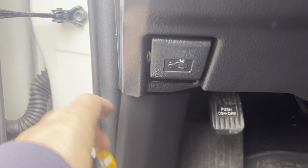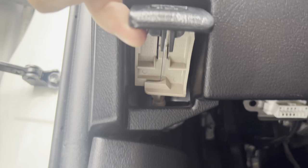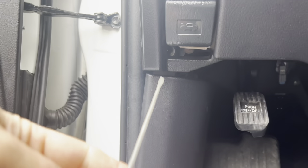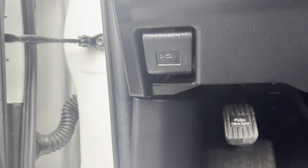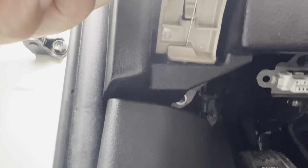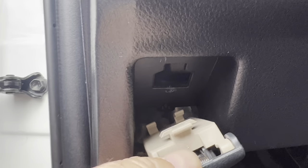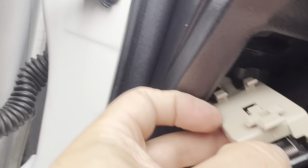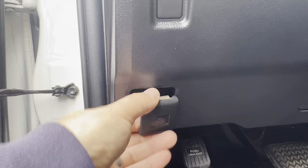Once we have that 10 millimeter bolt out, we've got to remove this. I've already popped the hood. Up near the top there is a little plastic pin that holds it in. We're going to take a pick tool or a flathead screwdriver, lift that tab, push this in, and the whole mechanism should pop out. There's a little flip switch right in the middle — you just pop that loose and it pulls out that little piece of plastic that holds it. That's what you'll be looking for — it's like a light switch in the middle. That's what will loosen this from that.